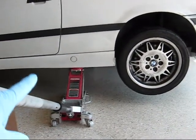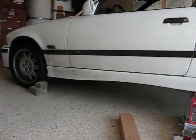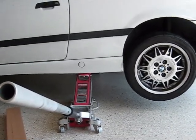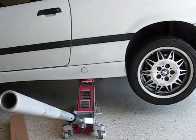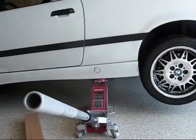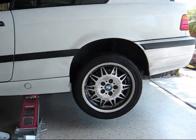BMW has a nice jacking pad built in at the back and front too, so you can jack right up on that — unless it's falling off, and they do fall off sometimes. So reach your hand under there and check if there's a pad there. Stick a block under the front so it won't go anywhere; generally it won't anyway, but that's just an extra safety measure.